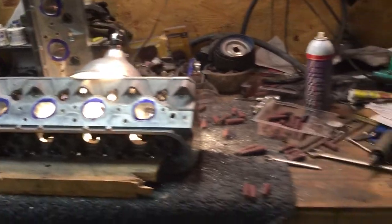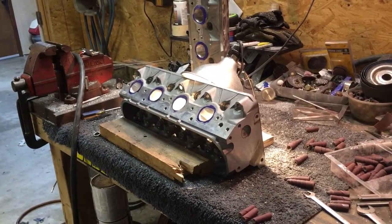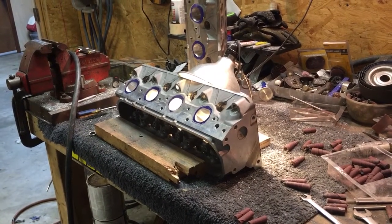When you start working on the intake side, you've got to leave a little bit of texture — even if it's just that 80 grit texture, you need to leave it on there so you can have good flow, maintain your atomization, and avoid any kind of puddling issues.